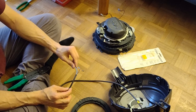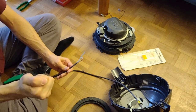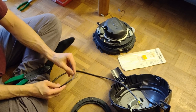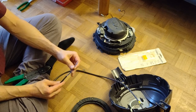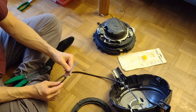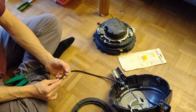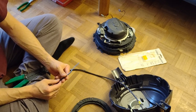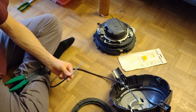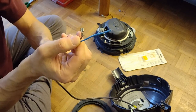But when you touch the plug sometimes from the wall, then you can feel that it is already warm. And I just lately saw a podcast where a guy had soldered the connection. I mean, you can properly solder it and maybe put some copper around it before you solder it so that you have a little bit of mechanical support as well. But his soldering got true to the heat. Well, he probably had quite a lot more heat than you just have on the plug on the wall. But it got so warm that the soldering actually melted, and then it burned his thing. So I want to crimp it. I don't want to solder it, basically.